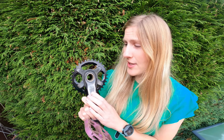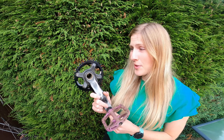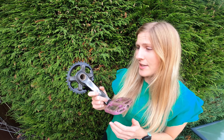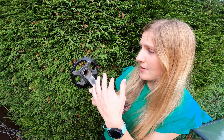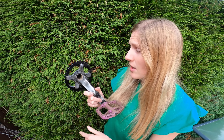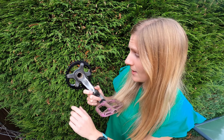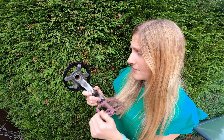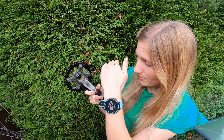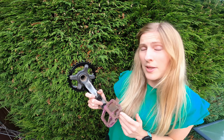Now I've got the chainring on the crank, let's have a look. Absolute Black have put a load of research and science into this — worth checking out their website for the detail — but essentially with an oval it's recognized that you don't have consistent power throughout the whole rotation. They've optimized the chainring so it's at its widest point when you're putting through the most power in the pedal stroke. So when you're recovering and then you've got maximum power output when you're pushing down, the idea is it will help with climbs.